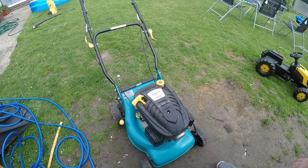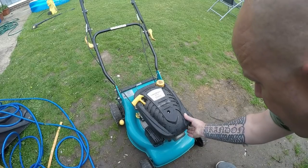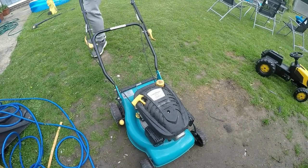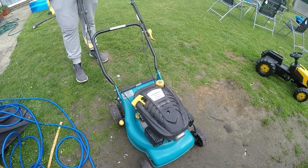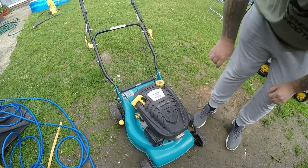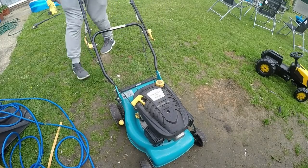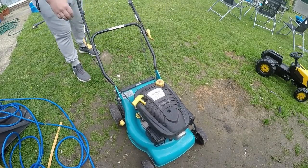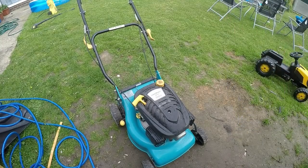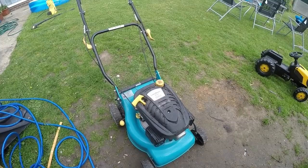Here it is - this is sold by one of the major shopping outlets in the UK. It's a little overhead valve job, a little 98.5cc engine, a little Chinese knock-off copy. The problem we've got is that you prime it two or three times at the start but then it'll just cut out. It's got a carburettor issue, I dare say. So let's get it up on the bench and get it looked at.